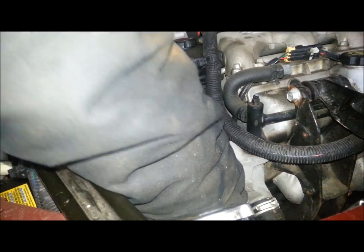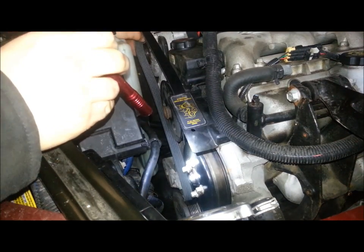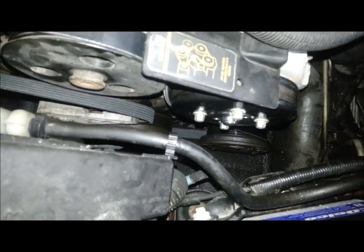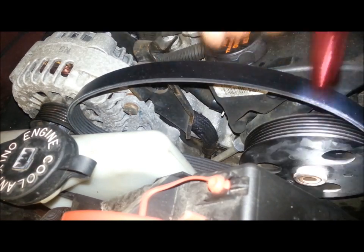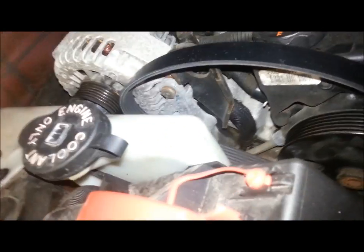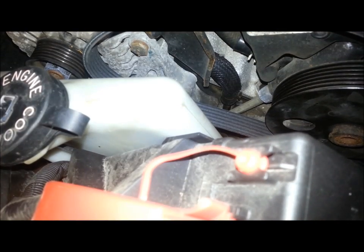For the most part, we don't look lined up here — we do look lined up. So now try to get as close to the alternator as you can. I have it kind of routed underneath there, over the tensioner. We are crooked in the tensioner, but that's okay for right now. Get your ratchet in the tensioner, move tension off the system, and when you move tension off the system, you can get it around the alternator. Now the belt is mainly on.